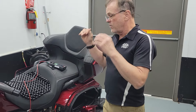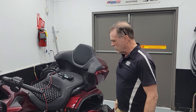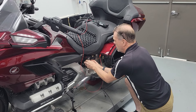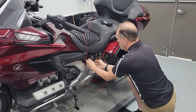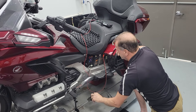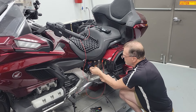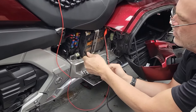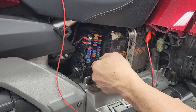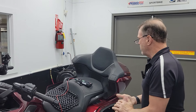This upload procedure takes about 15 to 20 minutes, so a couple of things: you're going to want to have a battery tender on the bike or some form of battery charger. I also recommend you pull the headlight fuse because that's just a big battery draw. Your little fuse tool is on the fuse lid — it's the third fuse up from the bottom, a blue 15-amp fuse for the light main. Grab that and pull it out so the headlight won't come on drawing a bunch of juice.